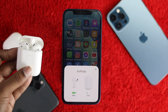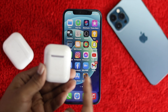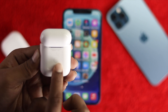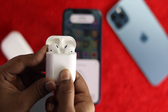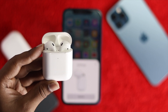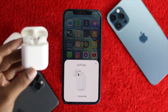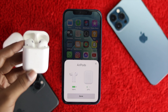If you tried that but still didn't get the pop-up, here's what to do next. Grab your AirPod case, open it, and on the back you will see a button. Press and hold that button and keep holding it until you see the light start blinking, then release. Wait until you get the pop-up on your iPhone. When you see it, tap Connect and check whether it is working. For those already connected who didn't get the pop-up, hopefully it will appear right after that and your problem will be solved.